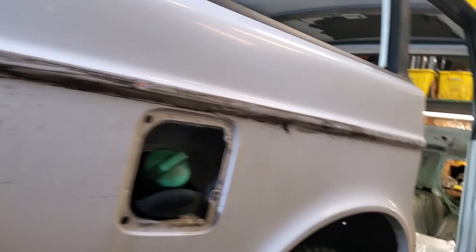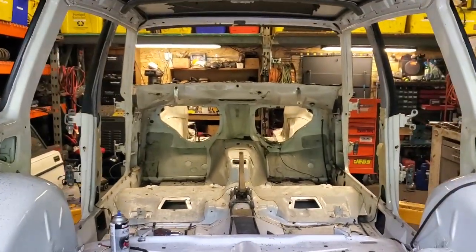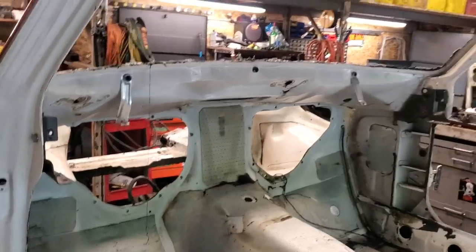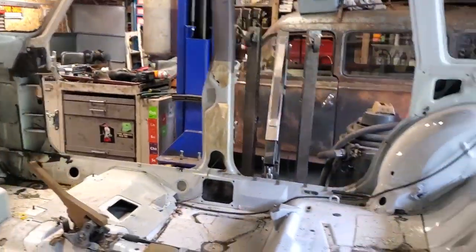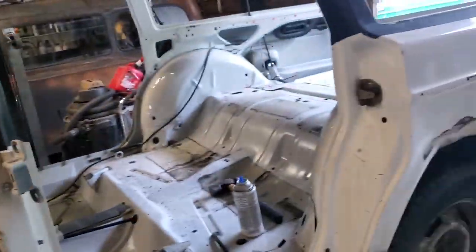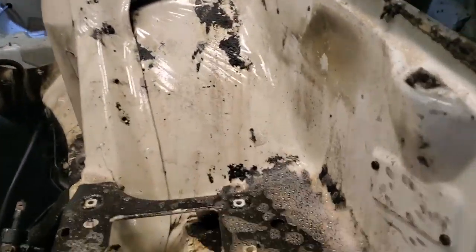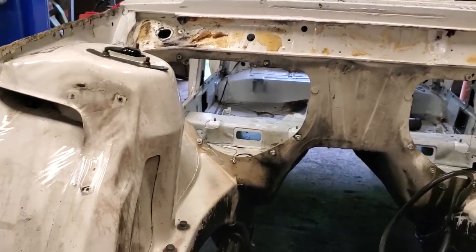As you can see, we've got it completely gutted now, with the exception of the parking brake handle and a couple of small bits. Have you ever seen a 240 that stripped before? It's the first time I've ever yarned a wiring harness out of one. Normally I just bundle them up and leave them, but the amount of work we're doing to this car, we figured we'd go full bore. I've got the engine bay soaking in Purple Power — if you haven't discovered it yet, you should. It is one of the best biodegradable degreasers available at most auto parts stores. We're letting that soak in and we're going to roll it outside tonight, let it sit in the rain, and then stop at the car wash for a complete pressure washing inside and out.